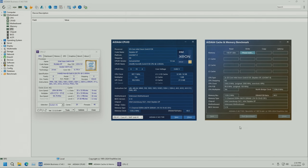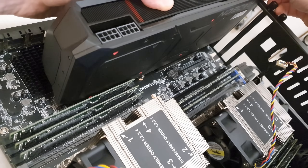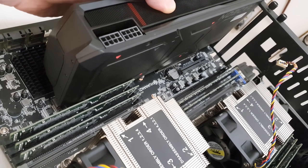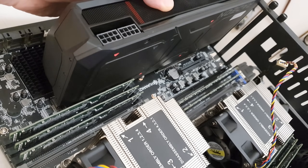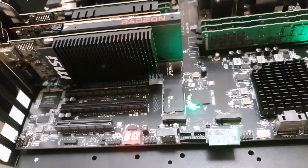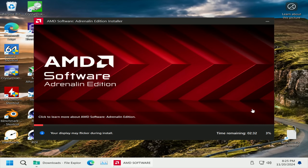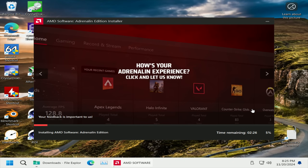The killer problem was discovered with PCIe testing. When I tried to install my AMD RX 7900 XT, I discovered I could not — one slot is blocked by a memory module and others are blocked by the large chipset heatsink. So I picked out my tiny AMD RX 6400 and tried to test with that. The motherboard would boot, but once I tried to install drivers, it would simply reboot. I tried multiple times, and as soon as I tried to install AMD drivers with the RX 6400, the system reboots.